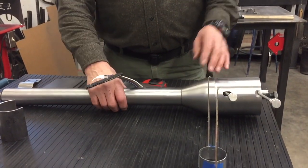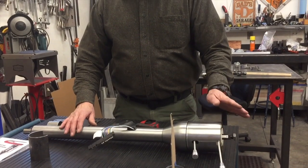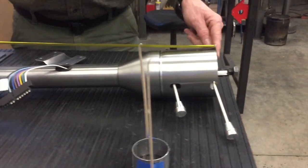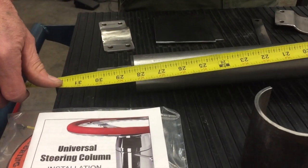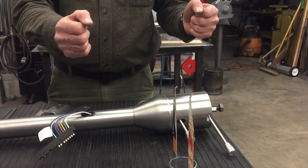When I was fitting this in the truck, taking the brackets off and on, I must have pulled this out of there over a dozen times, and it probably would have gotten scratched if it was chrome. So for me, this was a good choice. When you measure a column — or when you're buying one — they are measured from this edge to the end of the shaft. This is a 30-inch column. I ordered a floor shift column, so no gear selector, which made the column even more compact, giving me a little more arm room.